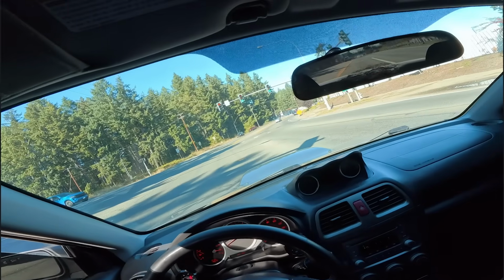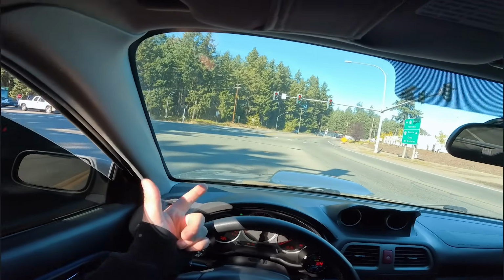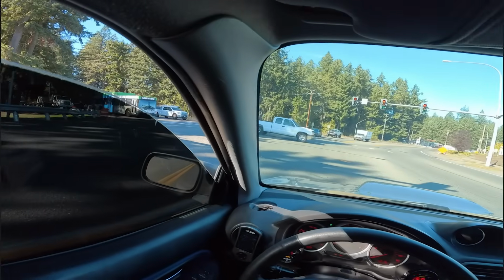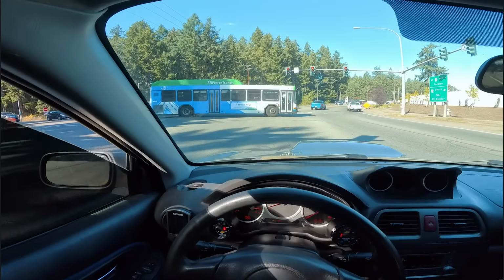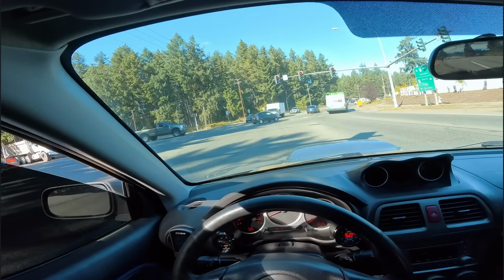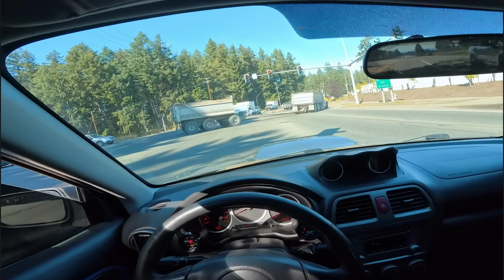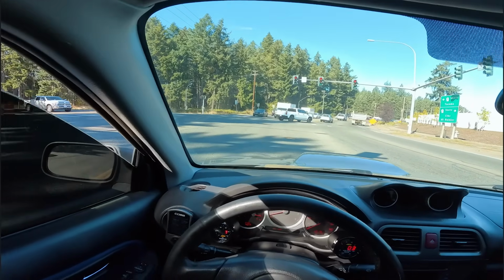If your car is seeing -4 feedback knock, yeah, it could be a timing issue, could be a fueling issue, it could just be picking up a detonation event. The overreaction to seeing -1.4, -2, -2.4 degrees of timing being pulled is the ECU doing its job. The ECU is supposed to be pulling that timing out if it is detecting these knock events. And if it detects those knock events over and over again in these RPM ranges or under these load settings, it's going to move that feedback knock into your fine knock learn. Your fine knock learn is going to be your long-term knock correction.